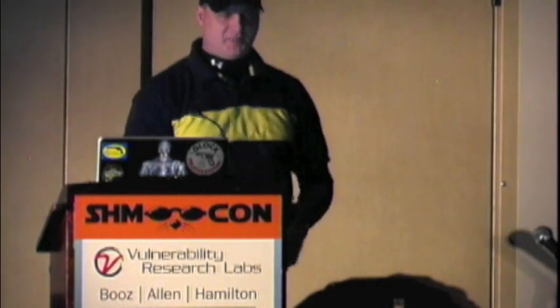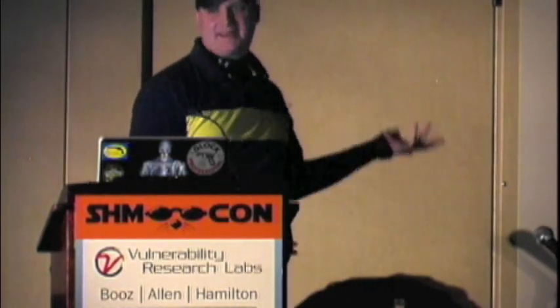Now, most of the time, it's because you had a crappy $50 power supply that you didn't want to spend $169 on for some really nice Cool Max or whatever, and it blew this thing, okay? You can tell a power supply by weight. If you can pick it up and it's heavy, then you had a good one. If you pick it up and it's light, that is not good. Spend the extra 50 bucks or whatever.